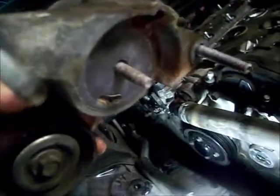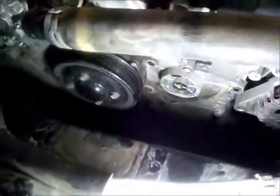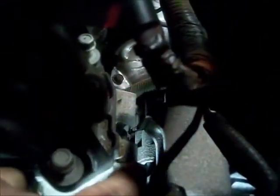I've removed the tensioner arm and the idler pulley that was bolted to the alternator. The tensioner arm has three bolts through it. The center one even has to come out. And took the accessory drive belt off. I took the inside alternator bolt out and left the other one part way in there. I'm not sure why the generator should have to be removed at this time, just to get a gap in this cover so it'll go back in there.